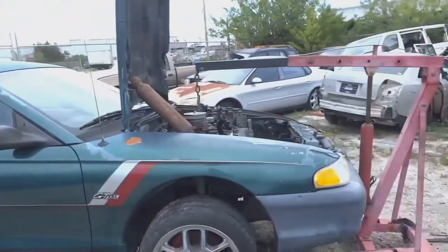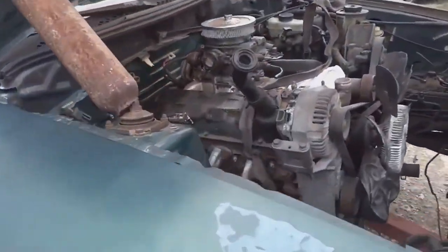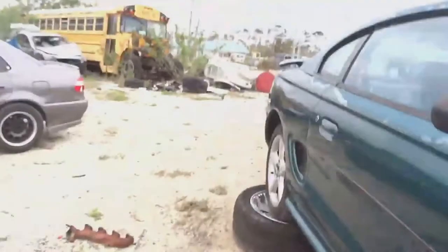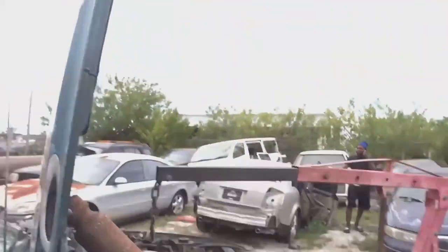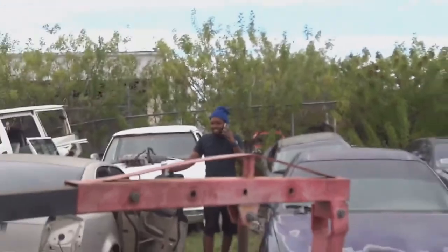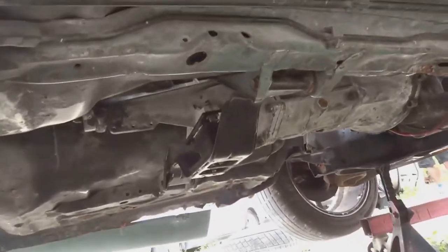All right, guys, we done worked the whole day away. We got everything done though. The engine mounts are in and bolted up. The T5 transmission is in and bolted up. My friend right over here, Shane, had to open up the holes for the brace a little bigger so that we could get the T5 mounted with that solid brace. Because we have all solid motor mounts under here, everything is bolted up.